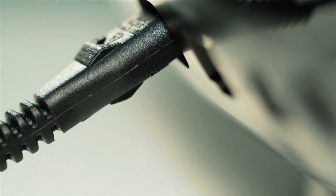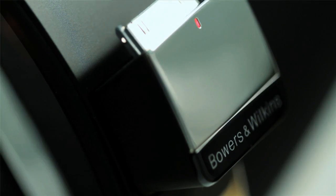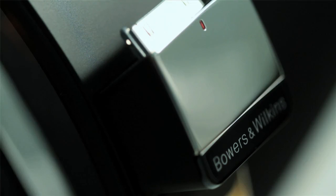To perform a factory reset, make sure your ZeppelinAir has been on for at least 60 seconds and then, using a paperclip, press the reset button next to the Ethernet port on the back of the ZeppelinAir. Hold it for 2 seconds, then release. The indicator light will flash red 5 times before settling onto a dim red. Now you can start the setup process all over again.